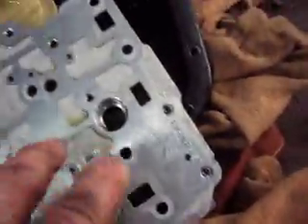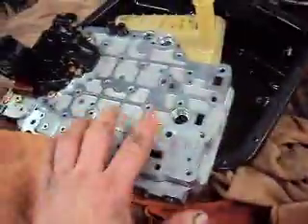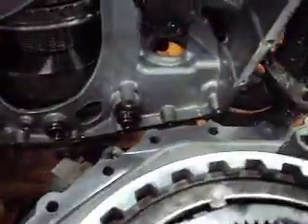There are eight bolts that hold this on. There's a chart on ShopKey to show you which bolts to take out. Here's our filter — a changeable filter if you want to drop the pan to change it. You've got to take the valve body off to split the case, because the valve body fits over top of these feed tubes and kind of holds the whole thing together.